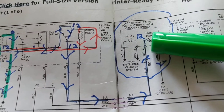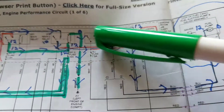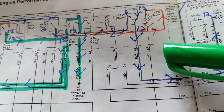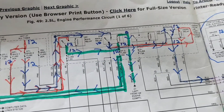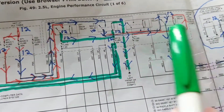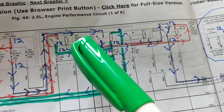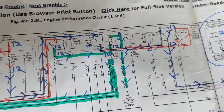To get to the fuel pump you'd have to go to the fuel tank — and you don't want to do that. You want to go under the hood, which is the easiest place to find sensors, fuses, and the power distribution board. It's about finding the easiest point of access to measure voltage. Again: one, two, three, four relays are involved.